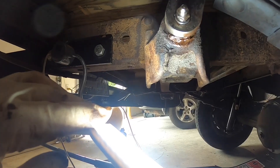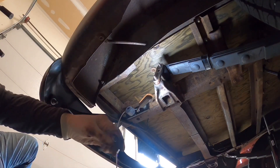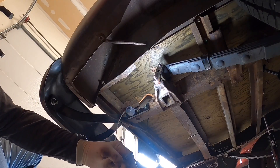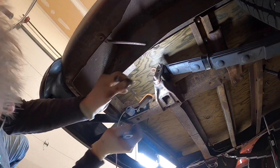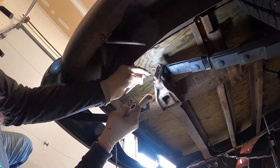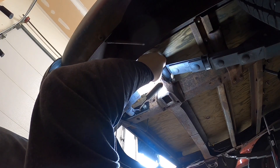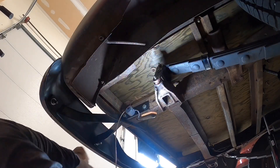This side's done and we're going to repeat it on the other side. Here's the old versus the new carriage bolt — we're going to use the same nylock. It was never into the nylock portion before. These are 9/16, squared off so it catches the carriage bolt. This retains the shackle there. Got to get the right angle on it — capturing the nylock.